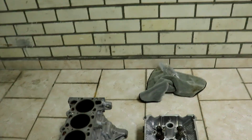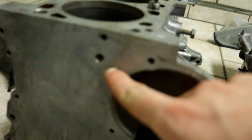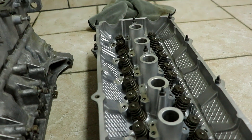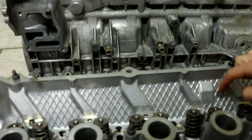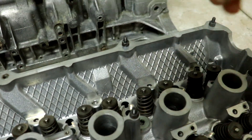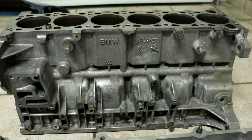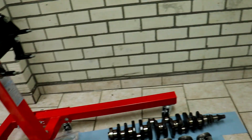The series got all shaken up so I have no idea which part this is, but we got the engine back from the engine builder. This is the hole that needed to get fixed - I'm gonna put a picture on the screen of what the hole used to be, and it's fixed now. Awesome work by the company that made it. The head is also repaired - on the exhaust side number nine there was a piece broken off so the spring could move incorrectly. That got fixed as well. They cleaned the engine and put all the springs and valves back in. So let's put the engine back on the stand and move on to final assembly.